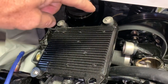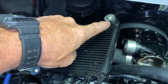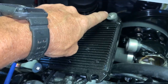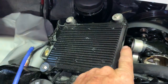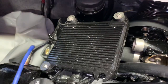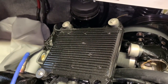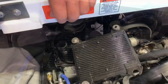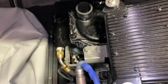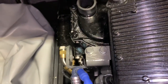You can see we have three screws here. We're going to loosen up this screw right next to the pump, using the 10-millimeter socket on top and the 10-millimeter wrench on the bottom. Be careful not to lose the nut — there's also a lock washer on the bottom, so be careful not to drop that. Now we're going to come down to the 13-millimeter bolts and loosen those up.